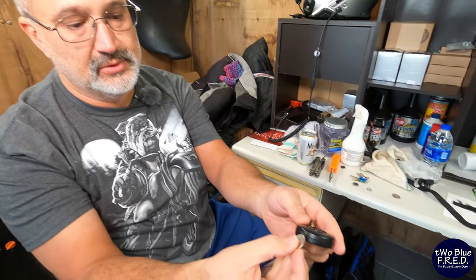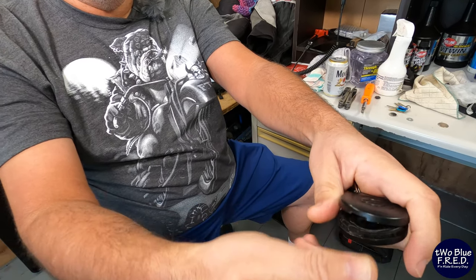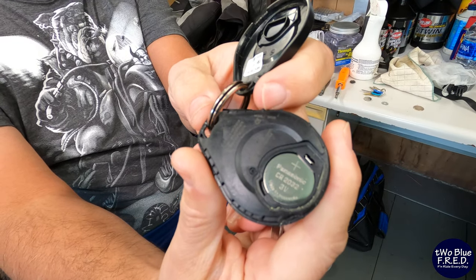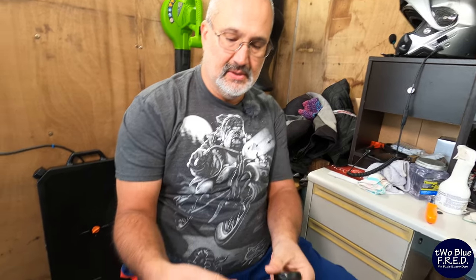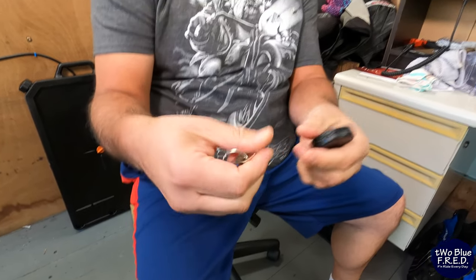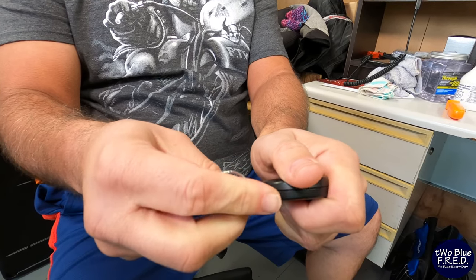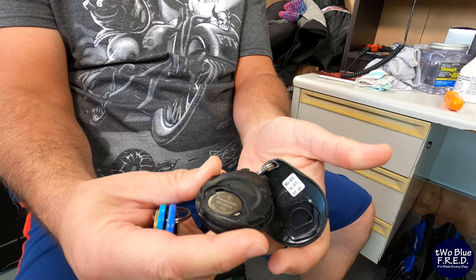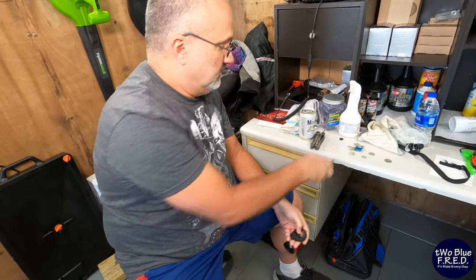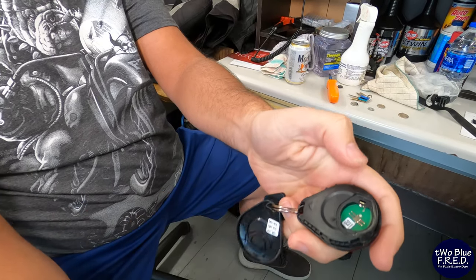What you do — just get in here with the nickel in the notch, twist it with this kind of motion and it's gonna open up. And there right there is the old battery. Let's say you don't have a nickel or any other kind of coin — most of us carry keys, right? Just your typical house key. If you get your house key in this notch and do the same kind of motion, you'll find kind of a flat spot — it's gonna do the exact same thing. To get the old battery out, go to a screwdriver. Got a little notch right there — just sort of pop that dude right out.